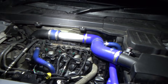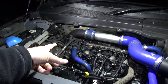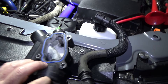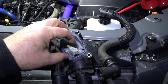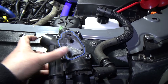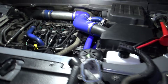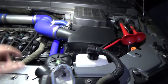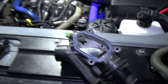Once the coolant has flowed through the EGR, it joins back into the hose that goes into the water pump — it joins in with the one from the header tank. There is another pipe along the back, which is a kind of bypass. When the coolant comes out the side of the engine, it flows round and into the thermostat housing, comes out at the bottom pipe, and goes along the back of the engine straight back round. Most of the coolant comes out of the big pipe and goes straight back round — the radiator is not involved yet when it's cold.